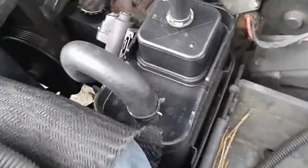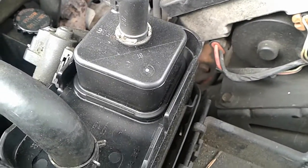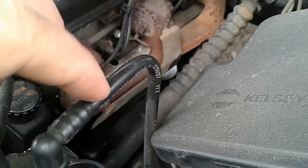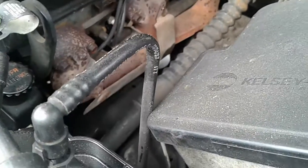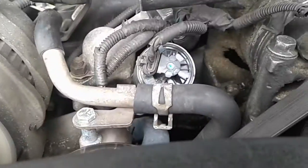There are some new parts — replaced the EVAP vapor canister. It turns out this line goes to the gas tank, so when you have that plug, that's what's leaking gas. And this one just goes to the purge — it goes on the other side of the throttle body. And then I had to put in a new EGR.